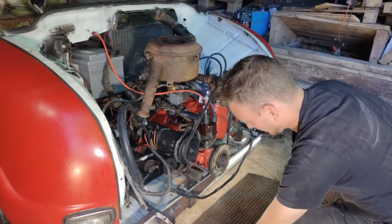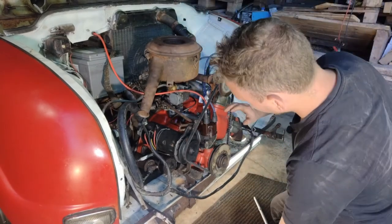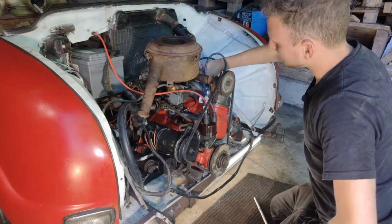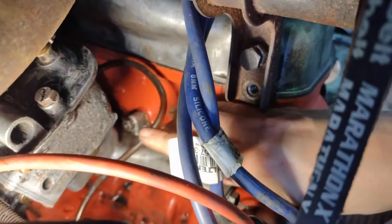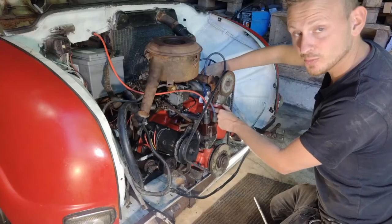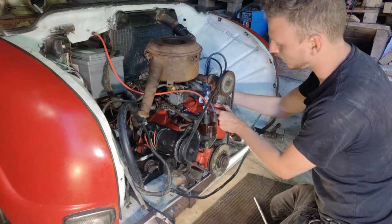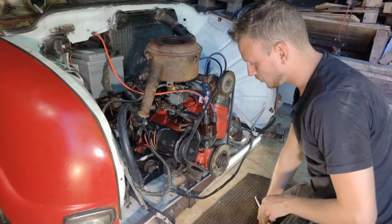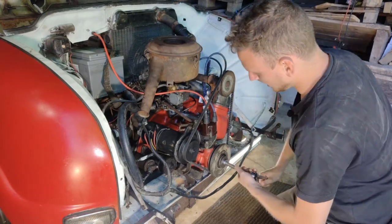Okay guys, I just brought my tools here, and let's take a look at this. It's actually the way with these old Saab engines that the second cylinder, and you can actually see it's written here on the block, second, first, and third, the second cylinder has to be on top, here on the top of the block. And there's actually some markings here that are nice to know as well, because if I set my wrench here on the engine, I can actually turn it.